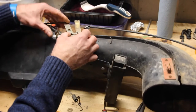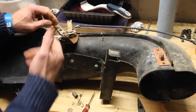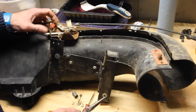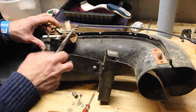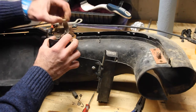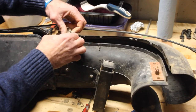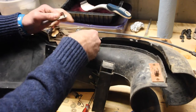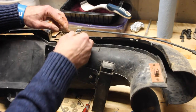Hopefully we'll be able to get into and take off that washer easier. That was a fail — I had to break it to get it off. Just couldn't get the angle on it and it wasn't coming off easy enough. I know Quadratec carries these, they're like 50 cents a piece. It's a pain in the butt, but oh well. Another washer — this is connected to the inside flap. Take out this slider piece. Plastic washer there, and there was a plastic washer underneath that connected it to separate it from this plate. So a whole bunch of plastic washers — looks like five in total.